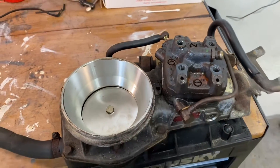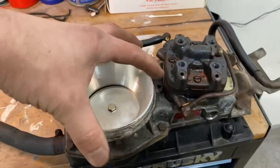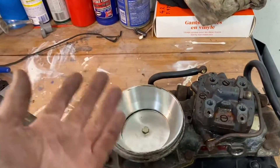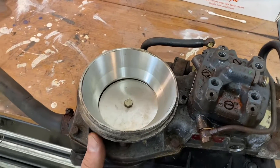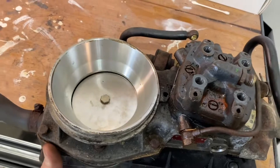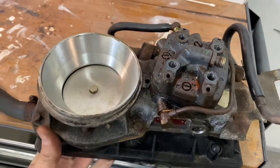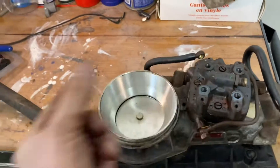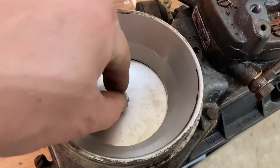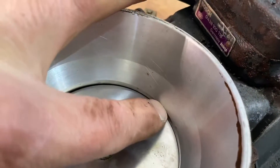Before I unseize it, let me quickly explain how this system works. As the engine sucks air to run, the more you floor it the more it sucks, and that lifts this plate up purely by airflow. The higher it lifts, the more fuel goes to the injectors. I feel like ours is set a little too low, so you have to adjust it from this edge.